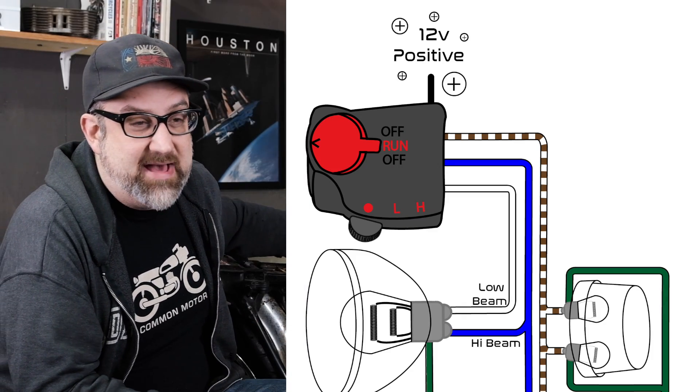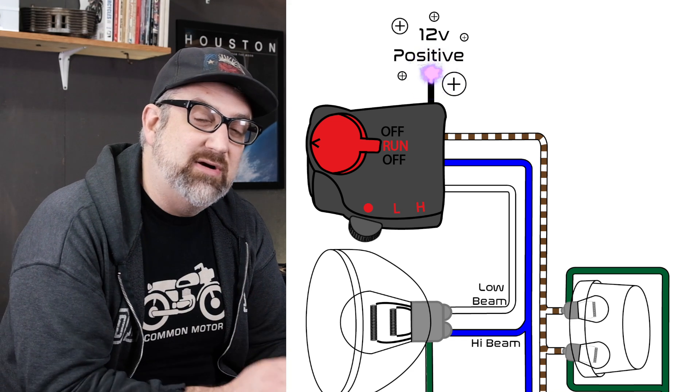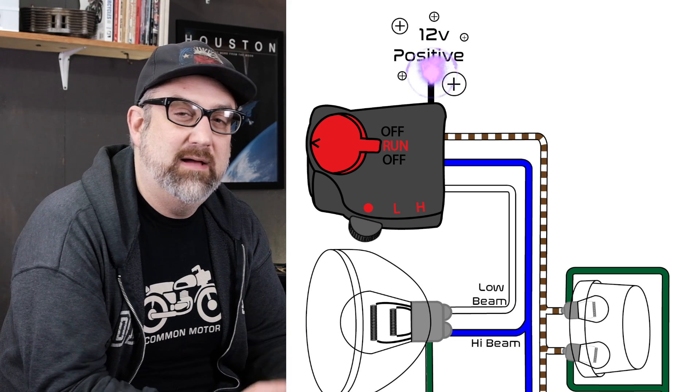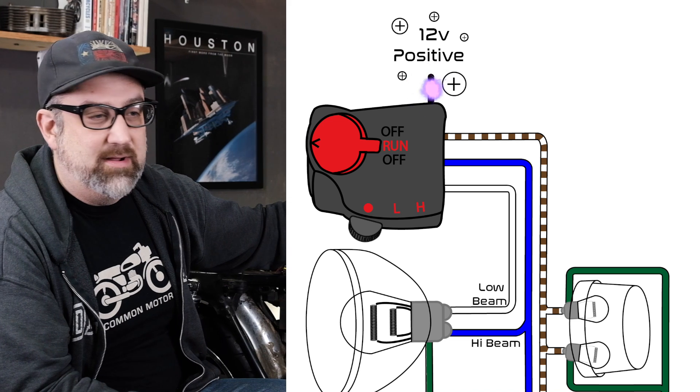When talking about the headlight bulb circuit, there are a couple different elements going on in the bulb itself. I'm going to work through the wiring diagram logic in reverse. We understand that things start at ground — the negative side of the battery — and run through the circuit, through the switches, back to the positive side. I'm going to approach it from the positive side because we have a couple different forks in the road, and it'll make more sense that way. On this bike, starting from the positive side, we have the positive side of the battery going to the key switch, changing from red to black. Solid black wires in this system indicate 12-volt positive. That solid black 12-volt positive ends up right here at the handlebar control for the headlight switch.